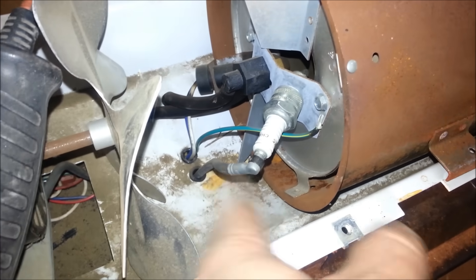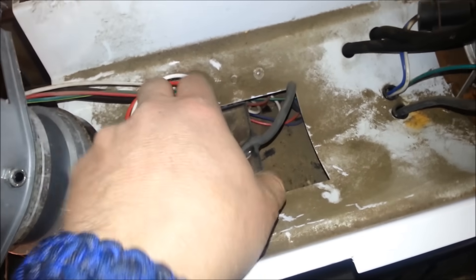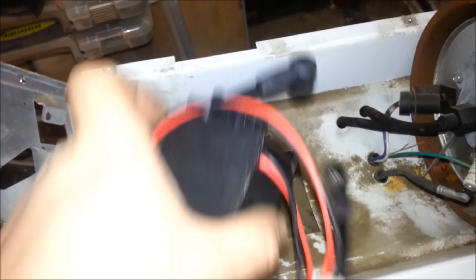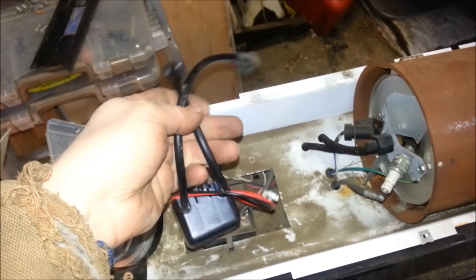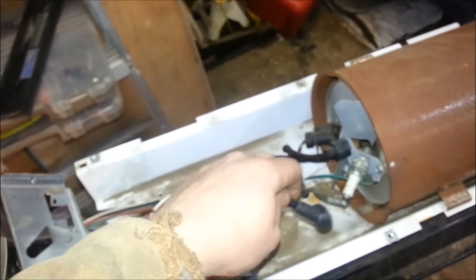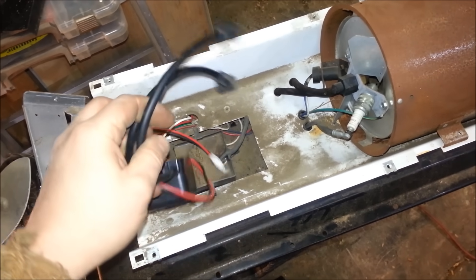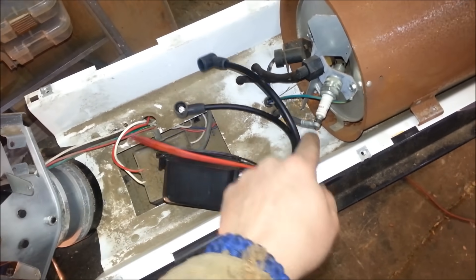Anyway, this one isn't sparking. So you have your spark plug, your spark thing, and your ignition coil — on this one it's just right underneath, right there. These are really basic, just two wires. If this does go out on you, if you're watching this because there's no spark, I just bought the cheapest one I could find. It just happens to have two spark plug leads, which I don't really care — I'll just dead-end one and the other one I'll just run to there. Having two spark leads just means it actually has two coils inside, so if one side dies one day, I can just use the other side. You just hook it up in place of your old one and route it right to the spark plug.